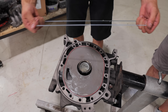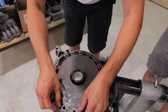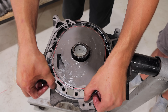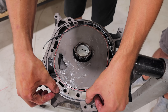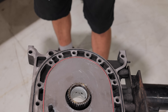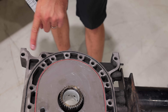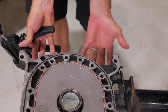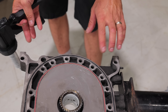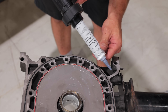The outer coolant ring is just a single rubber O-ring, and you do have to give it a little bit of a stretch — just a couple stretches — and then put it in the groove. If you stretch it right, it'll sit right down in there. Next step is to do RTV silicone on these legs. Your oil pan sits at the bottom of the motor here, and the RTV is strictly just to keep oil from seeping out of the joints.